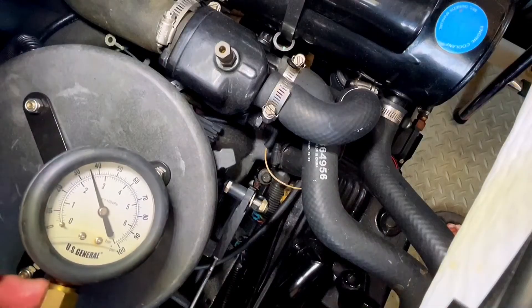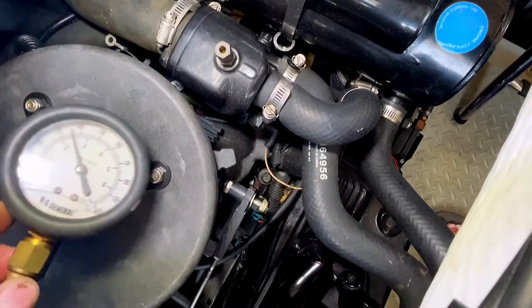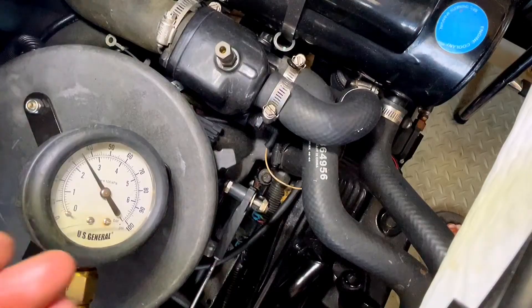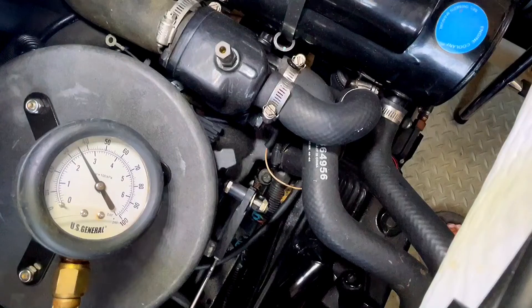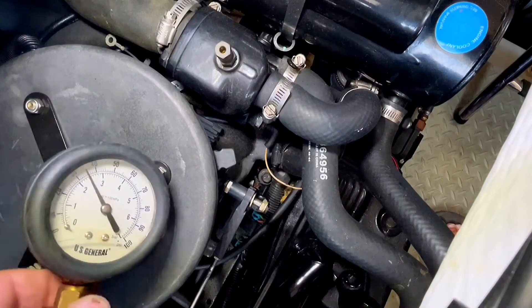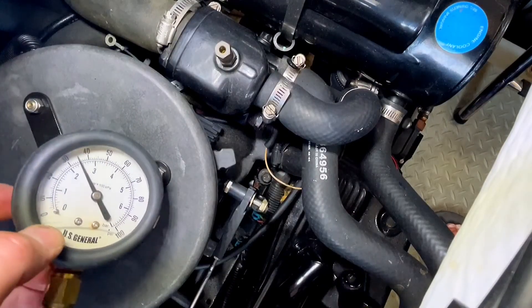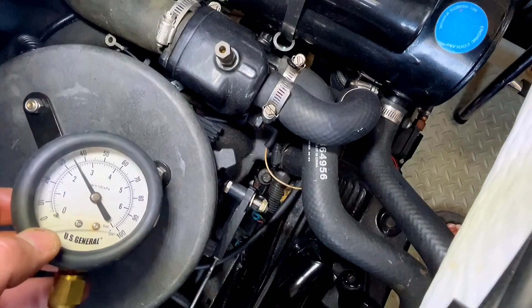One thing I did notice — my finger is a little wet. Some fuel is sweating through the fitting, so I could be losing pressure right here from the gauge connection. You can see it's wet — smell it, it's gasoline. So we're down to 35 now. It could be just that fitting, or it could be leaking back to the pump, or leaking through a clogged injector that's not closing all the way. But let's start it up and see what the pressure is when it's running.